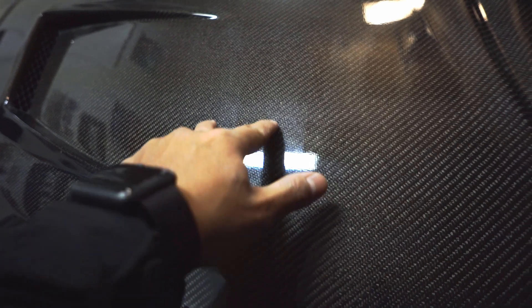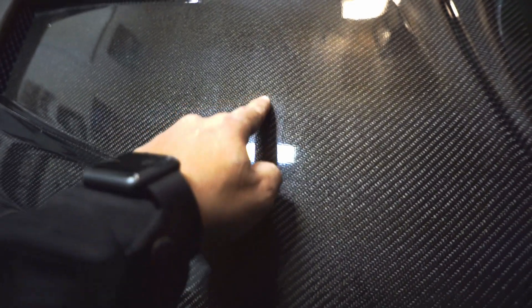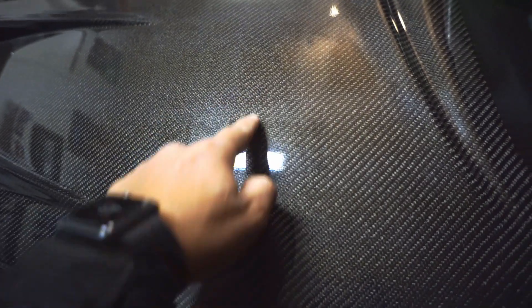Alright, now to reveal exactly what we did. Remember we had two pieces of tape coming this way — this side was the polished side, this spot right here had tape on it, this spot we wet sanded, and this spot was tape again. If you look closely, this is the polished section versus where we had tape — there's a little bit of haziness where the tape is compared to where it's not taped on the left side. Now on the right side square, look how clear you can see the overhead light compared to the tape section and the polished section. One is polished, two is taped, and three was wet sanded.